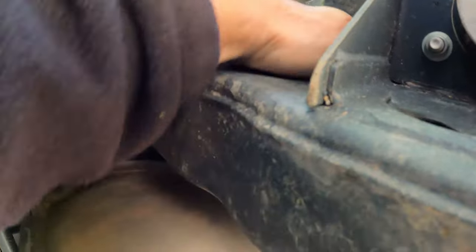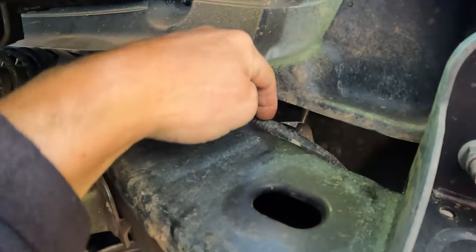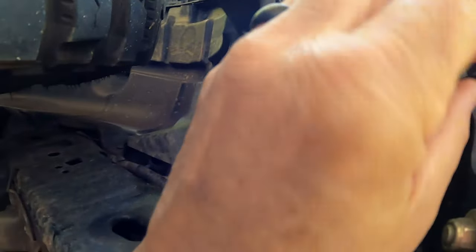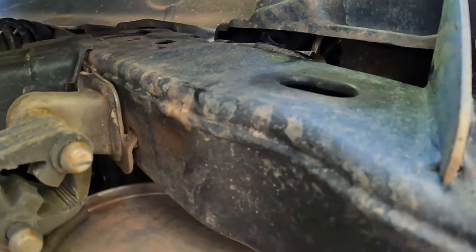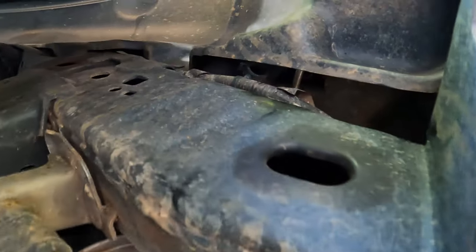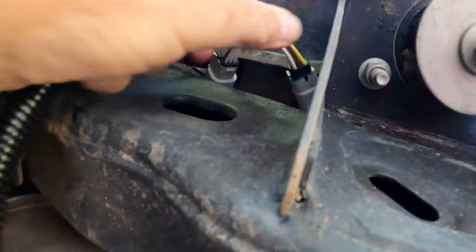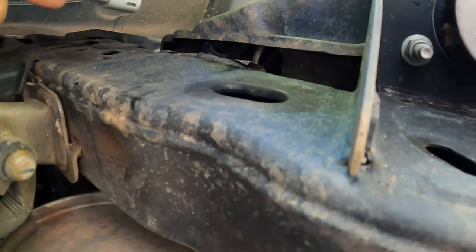There is a harness here. The instructions say to run it up alongside the wire. We're going to locate the side of the harness with the old wire from underneath the vehicle between the rear tire and the rear bumper, then route the wire up between the body and the rear bumper. Be sure to stay along the inside of the black cloth tape wire harness — though that might not be there anymore because the bumper was changed.